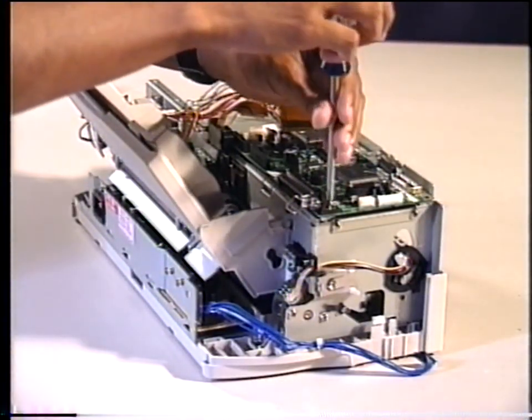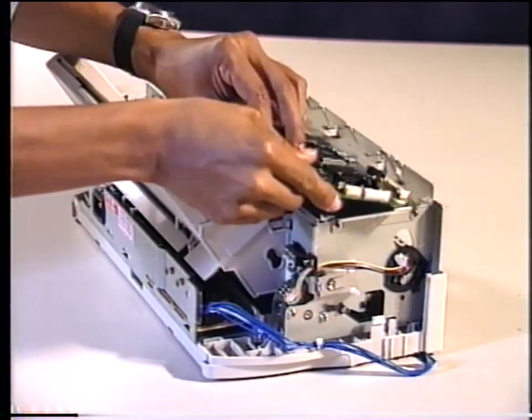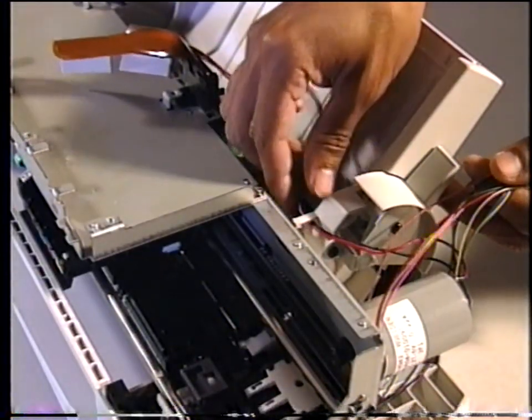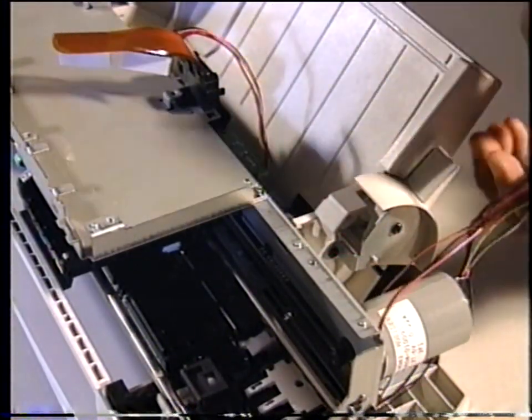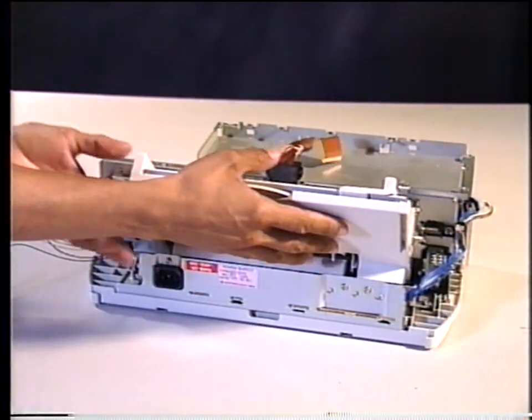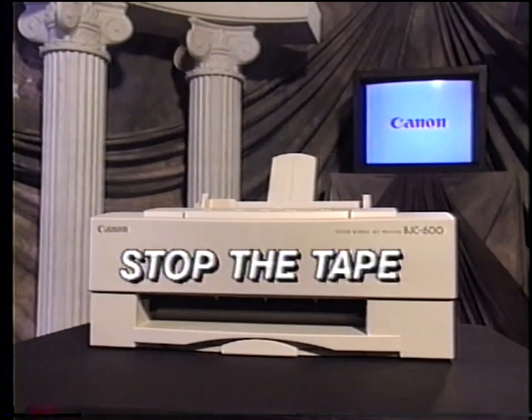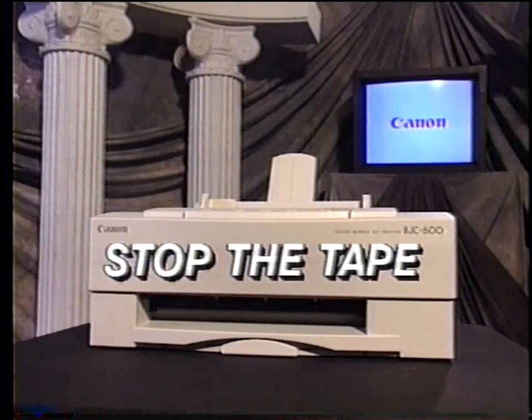To remove the control board, remove the three short screws and then the two long screws attached to the parallel interface. Lift out the control board. Remove the pillar from the front of the unit. Unhook any wires held down by the sheet feeder unit. To remove the sheet feeder unit, remove the screws at each side. Disconnect the latches on each side of the feeder. Carefully disengage the gears and lift off the sheet feeder. To remove and replace the rollers from the sheet feeder, refer to your parts catalog. At this time, prepare to stop the tape — remove the top, inner, and main covers, the panel board, the control board, and the sheet feeder. If you have any problems finding the correct latches, rewind this tape and watch the outer cover removal again. When you're ready, return to the tape. Now stop the tape.